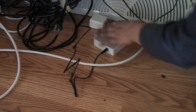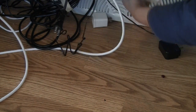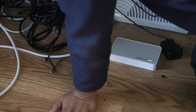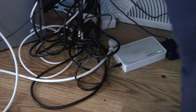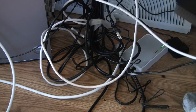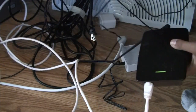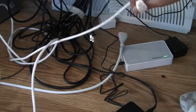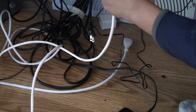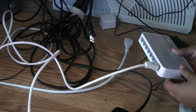After that, you should see a green light on your TP-Link switch, and this should be the power light because your power is on. After that, you can take the input connection from the router — in my case it's not a router but actually a wireless extender. If you want to buy the exact model, it's a KISCO one, you can go to Best Buy and buy it. So I'm going to take the output from the KISCO and plug it into port one on my TP-Link switch.